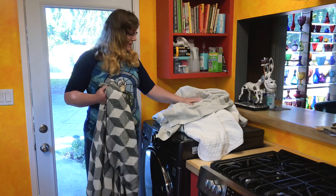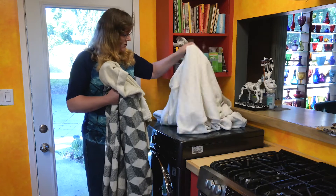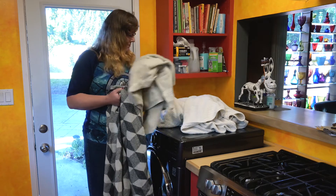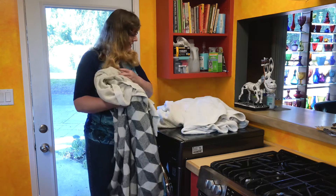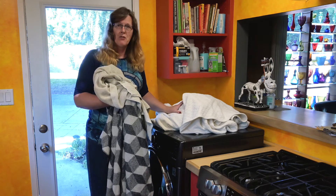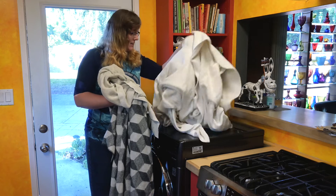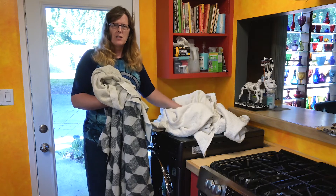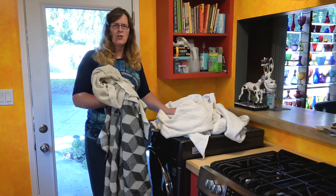After the two hours and 45 minute dry cycle, the lightweight blanket was 100% dry, but the queen blanket was still moist and the towel was still moist. Since it was nighttime, I pulled them out, shook them out, aired them, and left them overnight. This morning I ran the blanket for another half hour and it got more dry but still not 100%. I think I have to put it in for yet another half hour with no spin — it may take staged drying in order to get something this big and moisture absorbent dry in this machine.